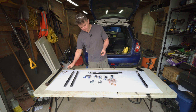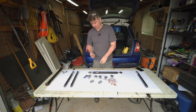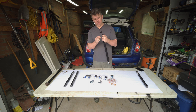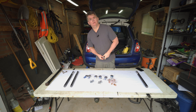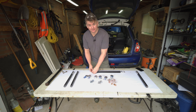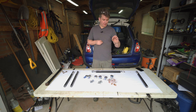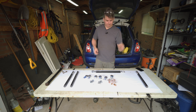I had to look around a lot for these spacers because they take the SAE size and step it down to 12 millimeter, but also their total width once installed is almost the same as the factory one — so I may have to put a washer or two in there. The important part is that the offset is in there so there won't be any banging when the arm moves around. I got these from an off-roading site — I'll put a link in the description — that's usually who uses these, people building custom tie rods for off-road vehicles.